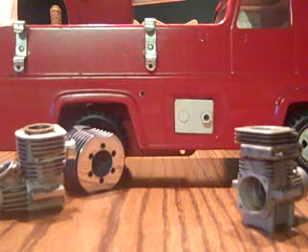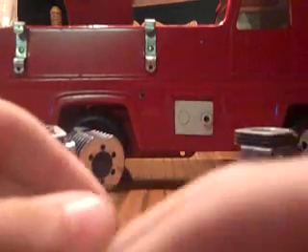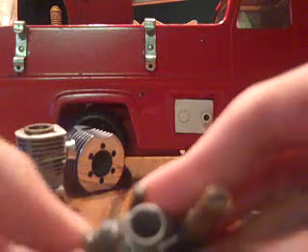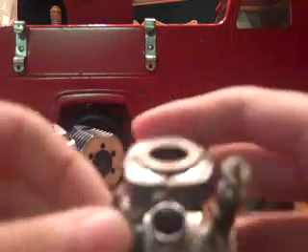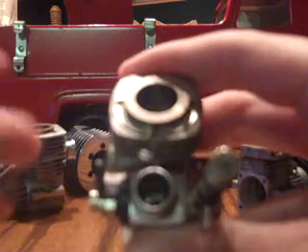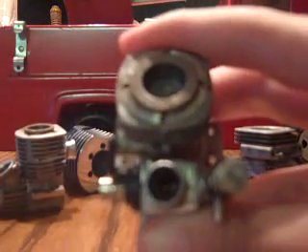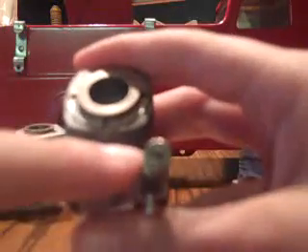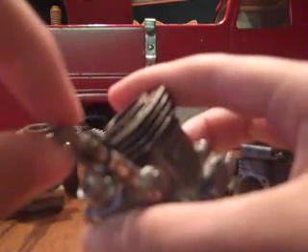Here's the carb — a rotary carb. It's a bit grungy but it's a carb. As you can see, this one is quite gummed up. You can see it close, barely letting any fuel and air in, which is pretty much at idle. At full throttle it opens up all the way. And that is the needle you can see down in there, which adjusts how much fuel and air it mixes in. This is the low-end needle, high-end needle — that's for fine-tuning, if I remember right. It's just been a while.